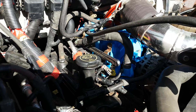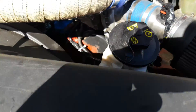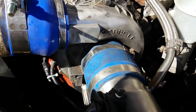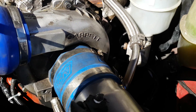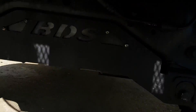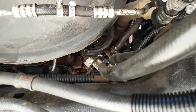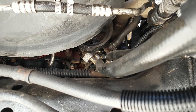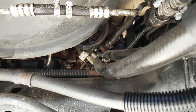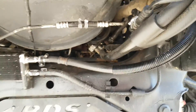What are the differences? I ran into problems with the exhaust manifolds being slightly different and not connecting well to the original exhaust system, so you'll have to modify that. Also the factory oil filter location won't work because the power steering pump mounts down there on the two-valve, so I used a remote oil filter housing off of a '99 or 2000 F150 5.4.